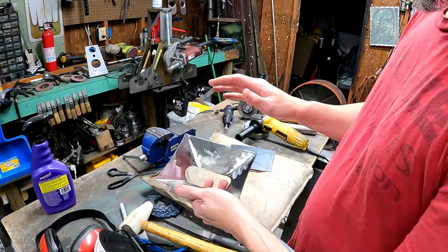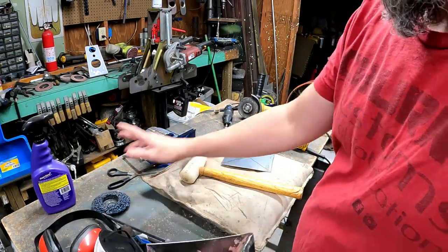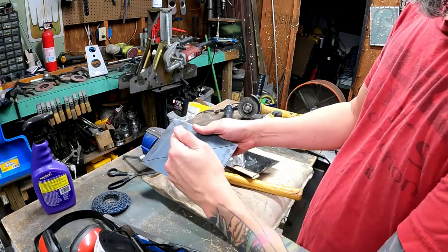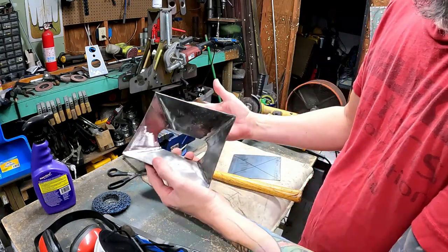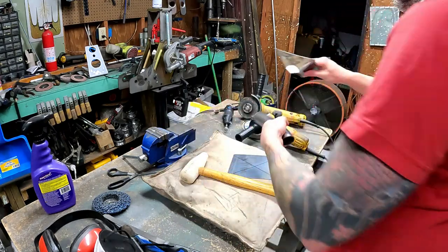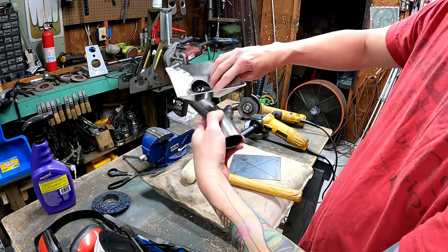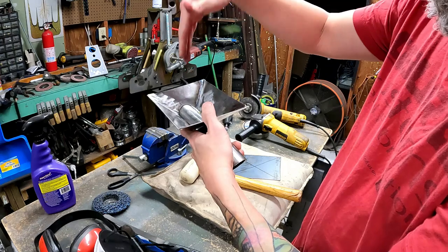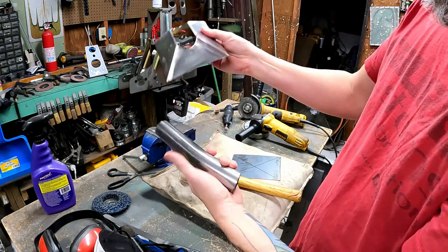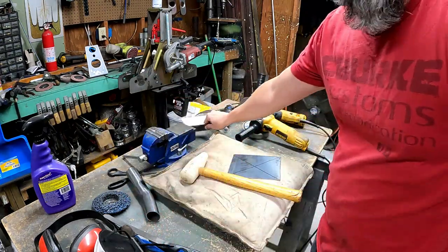Everything's all cleaned up with the tray. What I'm trying to do — and it's been years since I've done sandbag work and I don't even know if I'm going to be able to pull this off — is get this metal to concave so I can lay it down inside of here. I want to give the appearance of almost a pillow-type deal. The outside's fine, it'll lay on top like so, and then once the egg goes in, the tray will be all the way down. I'll add a rivnut, bolt through the egg so it holds it all in place and can be removed from the frame.